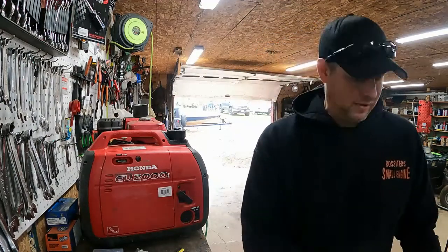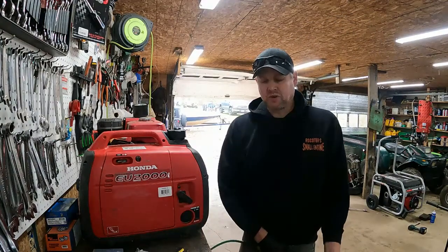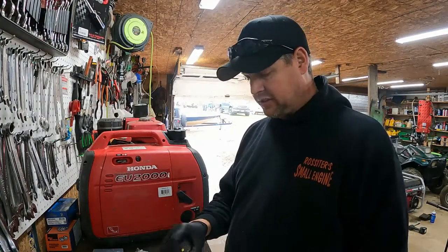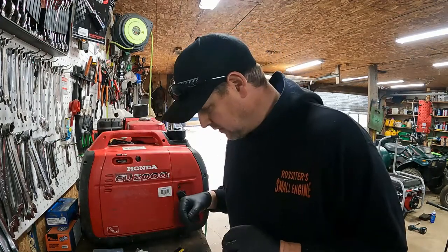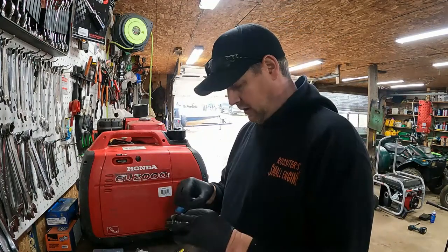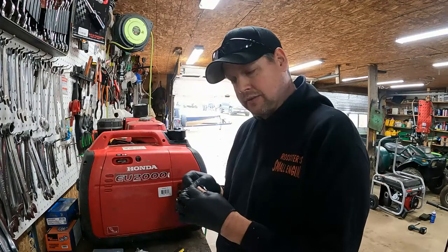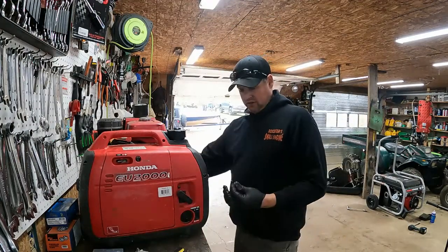Spray her down. Get the crap off her. Safety. Same thing. Just get the crap out of it. This is the main jet here. I can see through it, so that's good. Look, my gloves are deteriorating. Oh yeah. Ream her out a little. Clean her good. Blow her out, right clean. Let's put her back together.